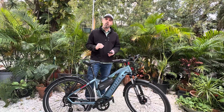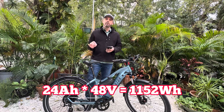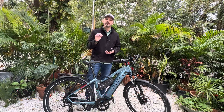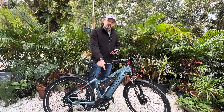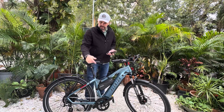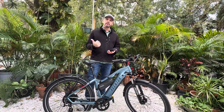My total consumption constant is 25 watt hours per mile ridden. So with a 48 volt system, you have a 14 amp hour factory battery plus a 10 amp hour second battery — 24 amp hours total — times 48 gives you 1,152 watt hours. Divide that by 25 and you get 46 miles. Now this is at 20 miles per hour throttle only, which is a good clip for the Aventon Level. You are not restricted to this battery — you can get any 48 volt battery you want. Just make sure the BMS matches the 22 amp current limit for the controller and that you have XT60 connectors. You can put a bag on the rack, saddle bags, etc. It can be any amp hour you want — just match your factory voltage and make sure the BMS for that battery works out.